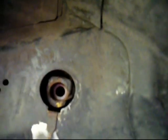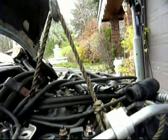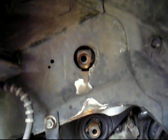Next we move to this 55 Torx that goes in there, but I'm going to have to use a screwdriver put in there as I wiggle around the engine supported by the hoist. That way the screwdriver will let me know when I'm close instead of only when I'm dead on. Then I'll put the Torx in there.